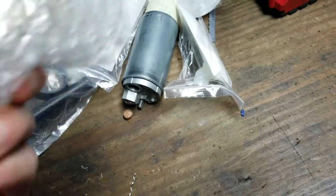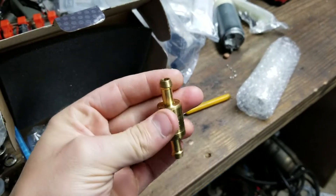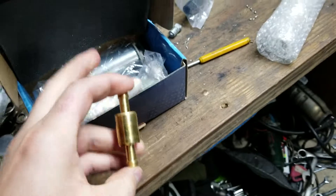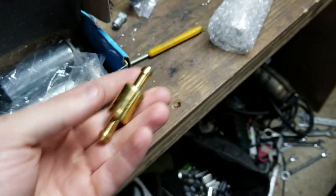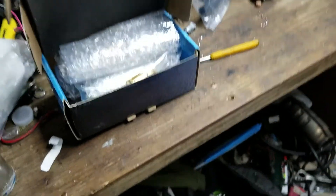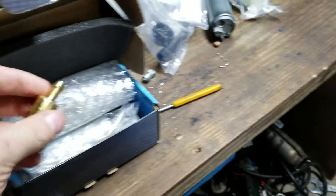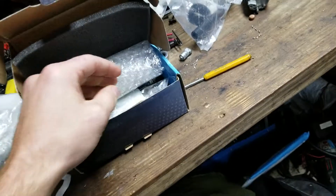I'm going to be doing a little tutorial on it because it involves a little bit of customizing. I also got fuel check valves for the pumps. When you go to high pressure pumps, sometimes you'll have hard first startups because they drain out, making startup more difficult. I was experiencing that with the Walbro 450s, and I'm putting these in just in case — I don't want to deal with hard startups at all.